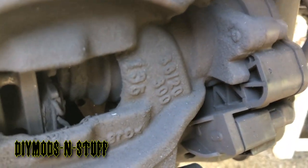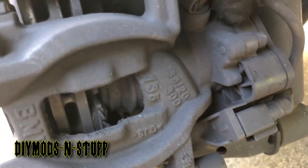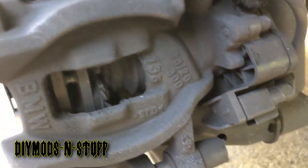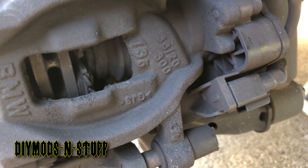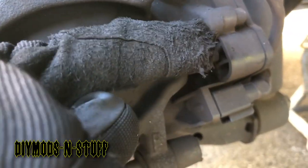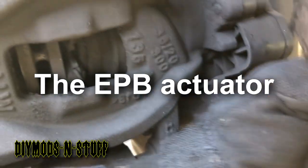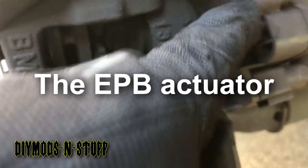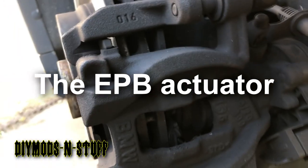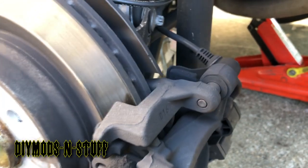What you're going to have to do is rotate the e-brake electronic parking brake actuator clockwise. On some of the previous models you can use one of those torx bits, but on this one the bit is sticking out — which is something I didn't find anywhere on YouTube.